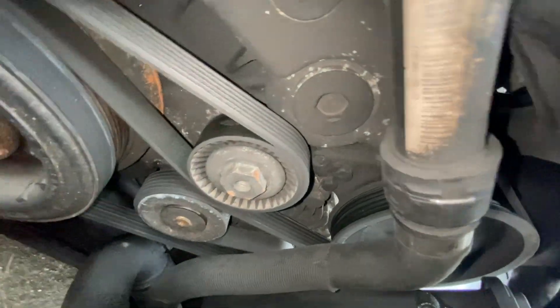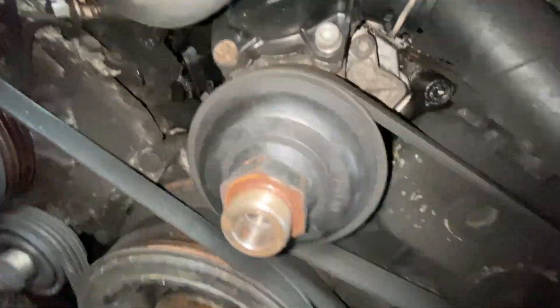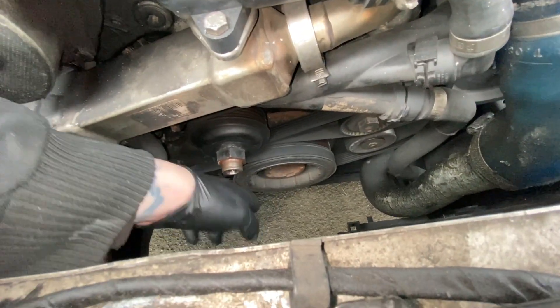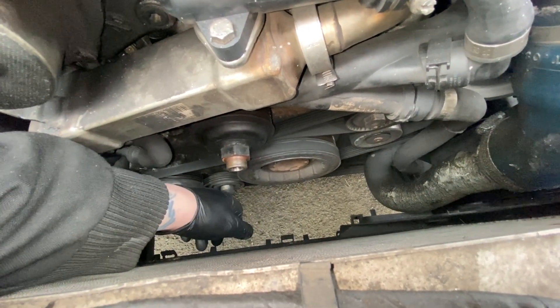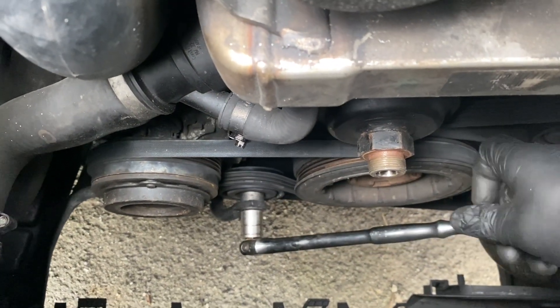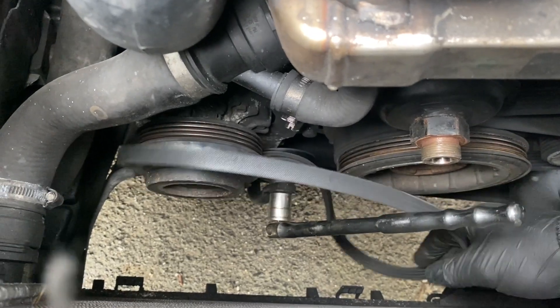Just make a mental note of which way the belt runs. Normally I draw a picture of this but I've got it recorded in front of me so I don't really need to do that. I thought the belt being still on and the ancillaries still attached does sort of help stop the pulley from turning a little bit, but then I just buzzed it off with a buzz gun anyway. Now let's undo that - this one is a 16mm, which just needs pushing downwards like that, and then the belt just needs removing. The next one is a 20mm, which releases by being pushed.